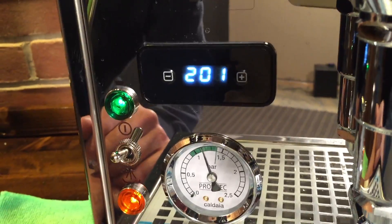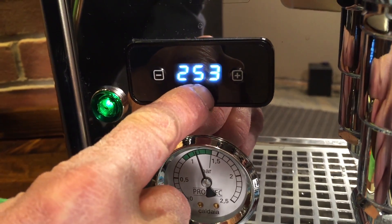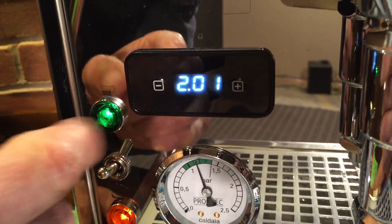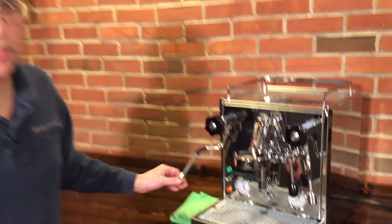You know you're in regular mode with that dot flashing in the temperature display. That little dot flashing tells you when it's sending power to the boiler — that's the object of the PID. It sends little pulses of electricity to spike it so it doesn't overshoot.